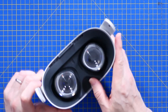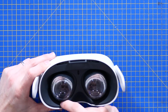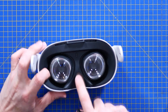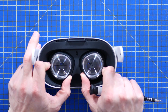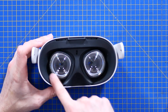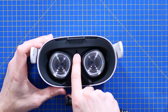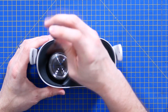We do have a series of very tiny screws — six of them I can just see in here. Now, one of the first things you'll probably notice is this down here, which has two functions. First, it gives you a number readout showing your interpupillary distance — how far apart your eyes are. Without that, the Fresnel lenses that make up the two main eyepieces won't be dead centre in front of your eyes. And just above it you've got a proximity sensor, very similar to the one on your phone, which turns the screen off when you hold it to your head. I'm imagining that's just a little infrared LED and receiver.